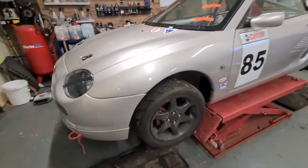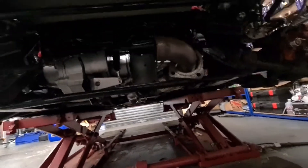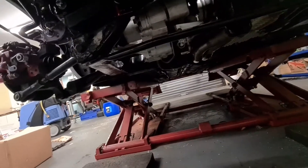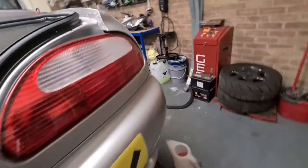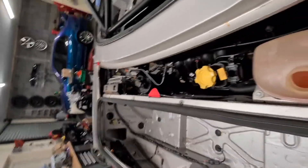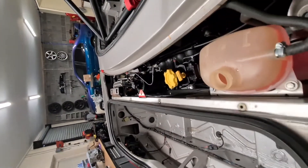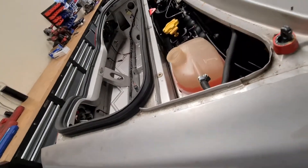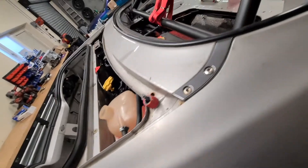There we go, that's all back together now - all the wheels are on, front bumper's on. There's been a few days since I picked up the camera. All the oil lines are now in, the braided clutch line is now in, I just need to stick the exhaust on at the back and put the rear wheels on. All the stuff is buttoned up at the top - charcoal canister, ECU, expansion tank - and that's now got some fresh coolant in it. I've been topping that up and left it over the weekend so it can find all the air pockets, but I still need to bleed the coolant and clutch system.